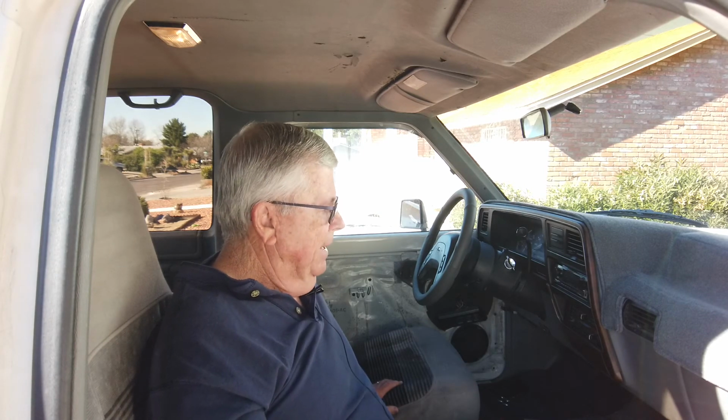Told you already, I think, that I adjusted all the doors. All the doors were out of adjustment. None of them were shutting properly. They were rattling. The spare tire carrier was rattling. All that's gone. About the only thing I'm dealing with now is trying to figure out where my radiator leak is. I think I may have narrowed it down to the lower radiator hose where it rests on the frame. I think it has a pinhole leak in it there and just barely leaks because I see a residue there.